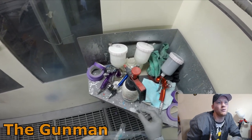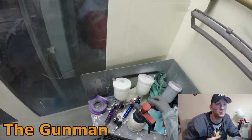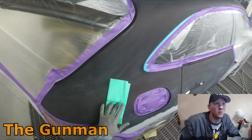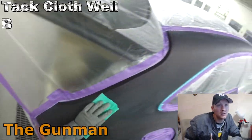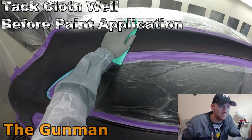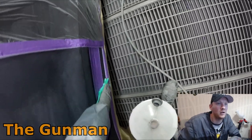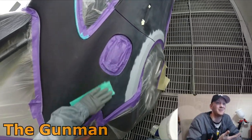I can flip the rag to the dry spot and wipe again to get any remaining liquid off — you don't want wet prep-sol or wax and grease remover on the panel when you're about to spray. I'm also wiping over the plastic masking, which I never used to do. Even if it stops two or three bits of dust per job it's worth it — takes 20 or 30 seconds. Those 2000 grit denibb discs are expensive, and less dust means less polishing, less sandpaper, and less time.